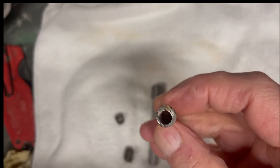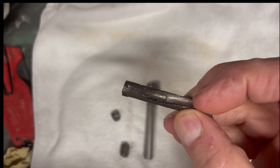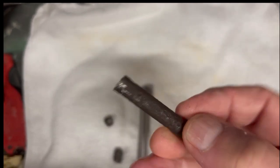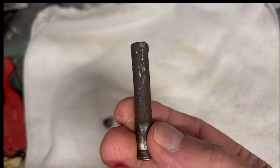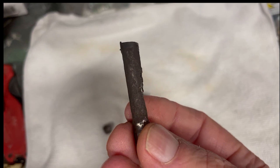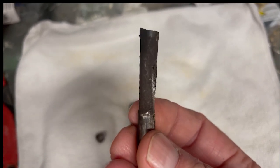There's my drill, which I thought was spectacular. It's actually pretty poor. I came right through it about a quarter of the way down, went way too far, really. So I probably nicked the hinge a little bit. But maybe more importantly, look how pitted that is. So almost undoubtedly, the hinge itself will need to be reamed. I'll need to shave metal inside that hinge because that's a lot of rust. So it's a little surprising, but that's why this thing was such hell to get out. But so let's take a look at the hinges now.